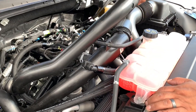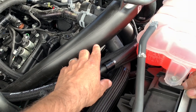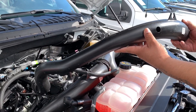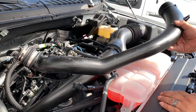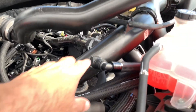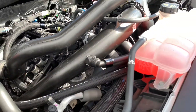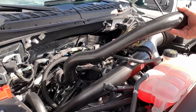We give you two options. You can take a step bit and drill into the stock pipe — the step bit ends up creating a 22-millimeter hole — then put the grommet in. Or for an additional $100, we sell the OEM factory pipe already drilled with the grommet hole. That way, if you want to return the car to stock, you can just take the UPR pipe out and put the original undrilled one back in. If you drill your own pipe, use grease on the step bit to capture any debris that could get inside.